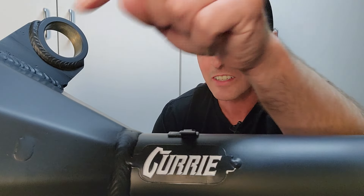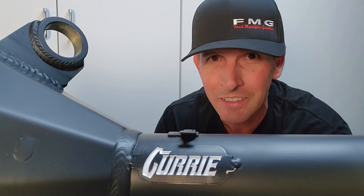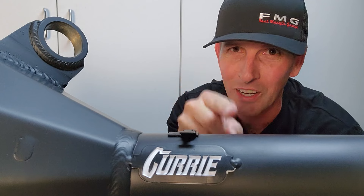I hope you guys learned a lot today, especially about the low-cost paint booth. Big takeaway on the respirator: I went through two of them and should have used three — one per coat. I was gagging at the end of the second coat, so throw it away before that happens. On a big part with a lot of overspray like this, change respirators each coat. Cerakote is the stinkiest paint I've ever used. It came out great and exceeded my expectations — I can't wait to do more parts. Next episode: final assembly and install into the GTO. If I've helped you out, consider joining the Full Monty Club. Building fast, driving faster — see ya.